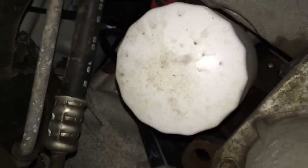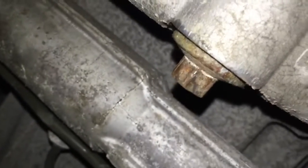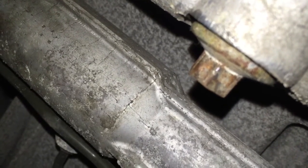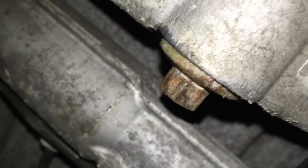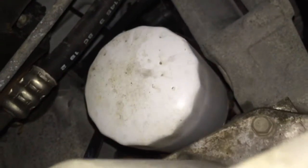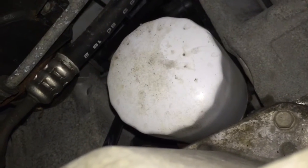Once you get the cover off, you can slide under and see the oil filter and drain plug for the oil pan right there — easy to get to. It's a 13 millimeter socket to get that off. Once you get down here, get your pan, drain it, put the plug back in, fill your filter up, replace it with the new one.